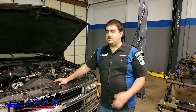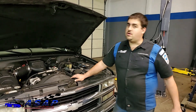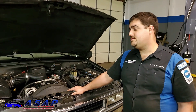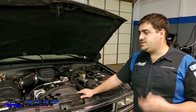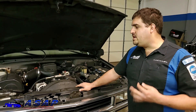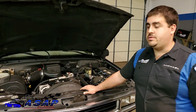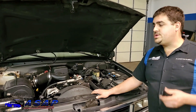All right guys, we're back at it with another How To's with Mike, and today we're back working on the Tahoe again at 200,000 miles — you've got to have a few issues. One of the issues I'm having is this thing liking to upshift a little too quick, and a few other different issues that have been bugging me. I've known I've had this issue for a while, just been too busy to get to it because we've been wide open in the shop. Long story short, I need to replace the TPS sensor.